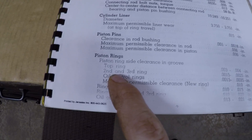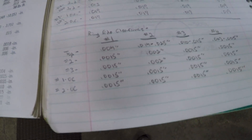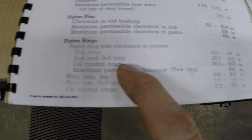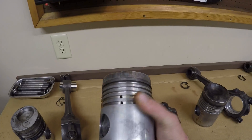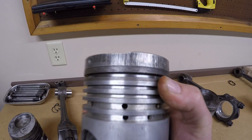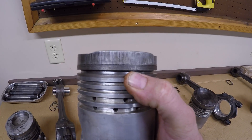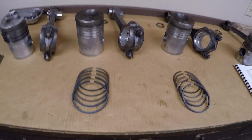It's a shame because the rest of the piston is good — all four pistons are good and every ring groove below the top was still well within spec. Second and third rings were 1.5 to 2.5 thousandths spec; I was running 1.5 on all of them except number two at 2 thousandths. Oil control rings spec is 1.5 to 3.5 thousandths; I was running 1.5 on all of them. Basically everything below the top ring on pistons two and three is still good, but I just do not like excessive clearances like that on the top ring of a compression ignition engine.